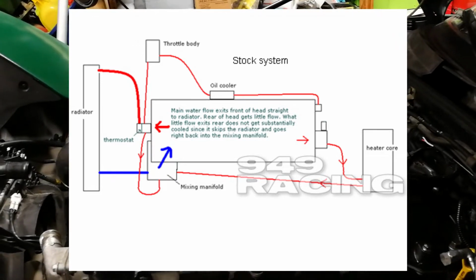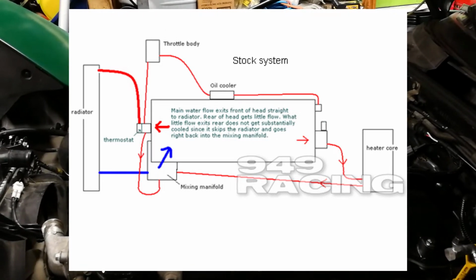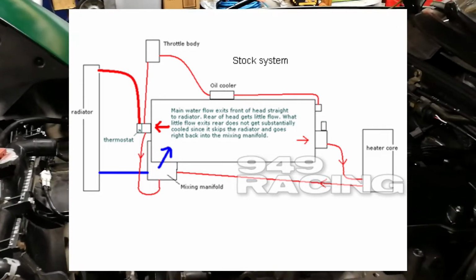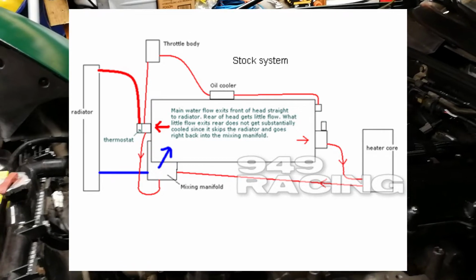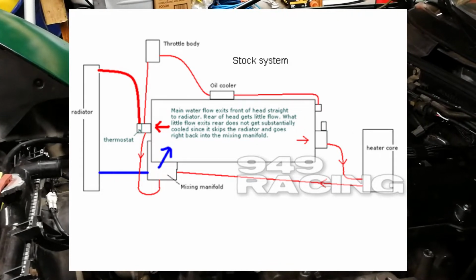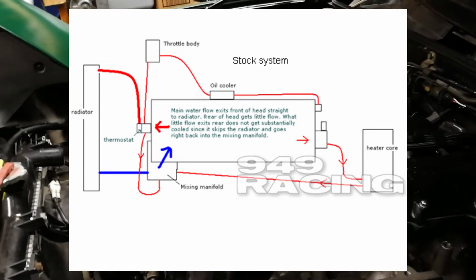And so it's a very small little coolant block that is right next to the oil filter on the passenger side there. Then the line continues up and connects to the throttle body, and it provides some sort of de-icing capabilities for the throttle body in general, so there's no sticking, and the idle air control valve can work correctly and get a little bit of warmth in a cold environment. Also, not considered terribly critical.